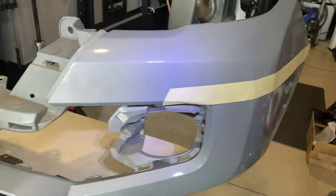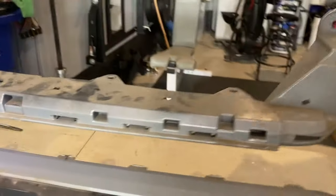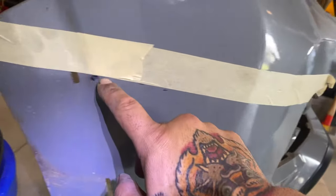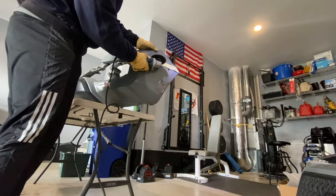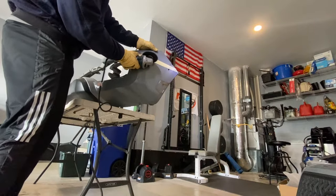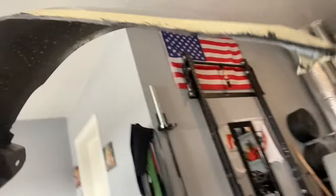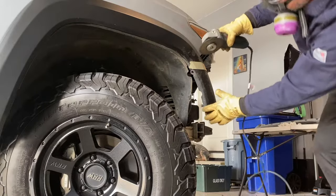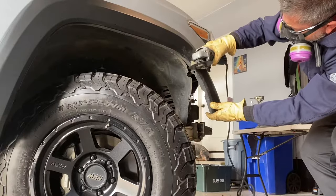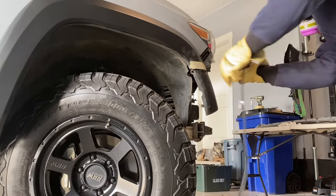Just the top portion we're keeping, so make sure you cut this right — take your time. Go straight across from one end, follow that masking tape all the way to where the fog light used to be, and do the same on the other end following that masking tape. Now you're ready to cut your fender flare — be careful not to cut the plastic spacer piece behind it. Cut some of it off, not all. Put masking tape on there and be very gentle; take your time.